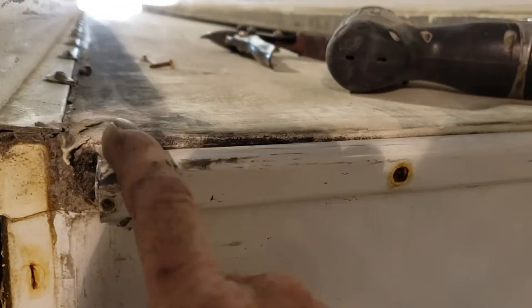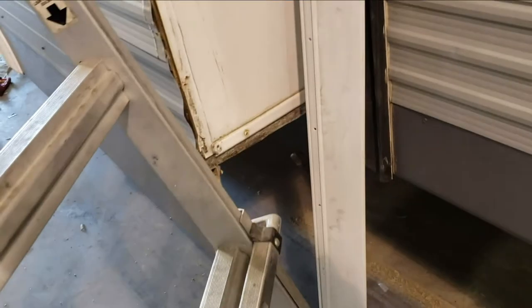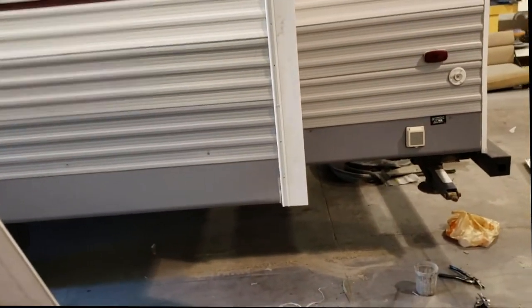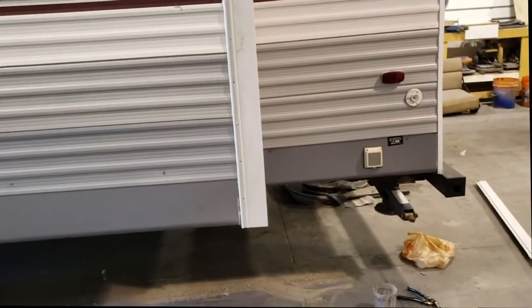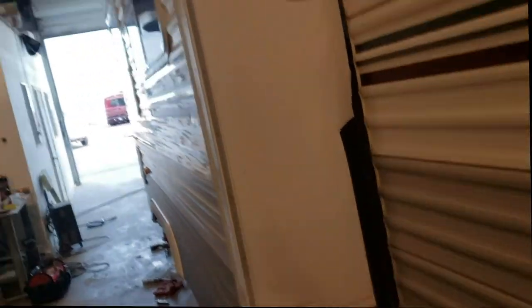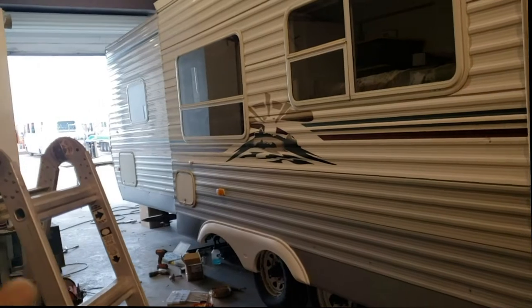I have concerns about this one because that screw broke when I took it out. I'll run the slide-out all the way out when I'm done and put a cap of sealant on top of here — that's just going to be flashing that helps redirect water. I'm going to do the same thing with the trim down at the bottom, so let's put it back together. I'll set this in place so I know how short to cut it. Well, I think it's always better to be lucky than good — that's the perfect length, I don't have to cut it any shorter. I'll just take it off, seal it up, put the screws in — more screws down there and on the side — and we're going to be nearly done with this job.